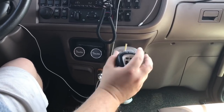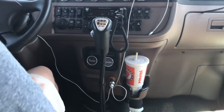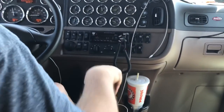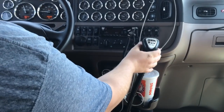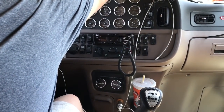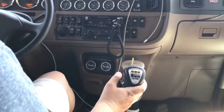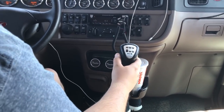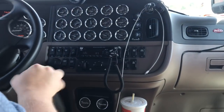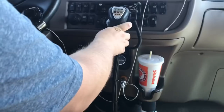We got a red light here. Then you split that up and of course that's tenth. Now you guys have all seen the low range — this is what I do even when I'm heavy at 76,000 pounds. We just take off on the low side and stay on the low side. There's no need to split these lower gears unless you're well over 80,000 because it's just a real real low gear. Some would say it's overkill for a dry van — there's no such thing.